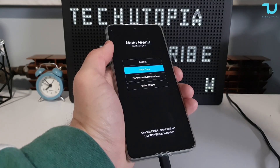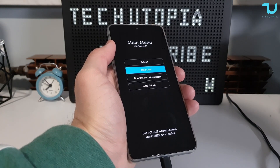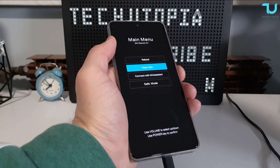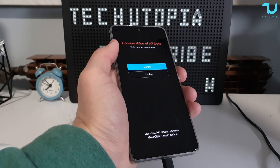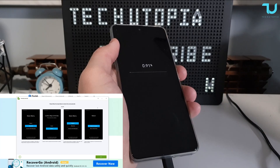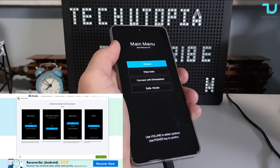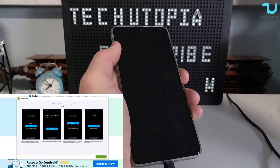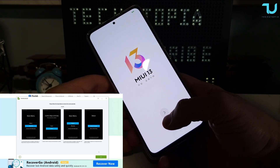Okay, this is what it gives us here. The phone is connected and we're following the on-screen steps. We're going to confirm wipe of all data. Let's go back to the menu — wipe all data — and confirm yes. Then go back to the main menu and simply reboot to system. That's it. This is how we remove the screen lock — just wipe the data.